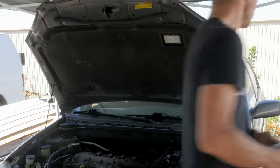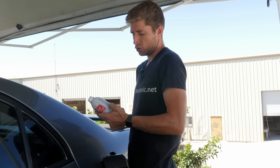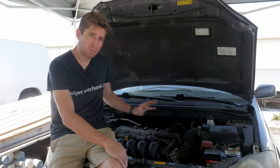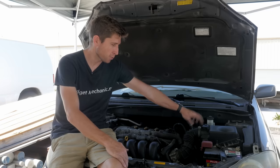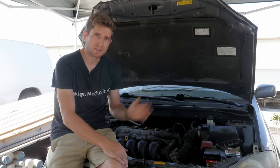With fuel system cleaners, it's going to take you a tank or two of gas before you start to feel the results, so follow the instructions carefully. On this Seafoam, it says to add two ounces for every gallon of gas — I've got about eight gallons in this car, so I'm putting in 16 ounces, which is a full can. The most common causes for rough idle in your fuel system are your injectors and maybe even your valves. You can remove your injectors and clean them out, or use a more aggressive valve cleaner sprayed into the intake. But definitely start with that fuel additive first because it doesn't require any disassembly.